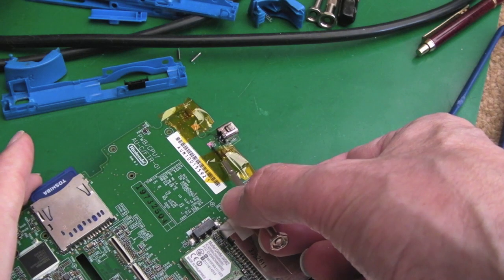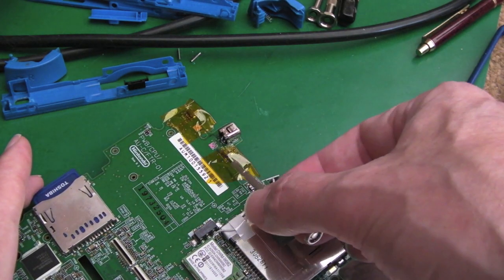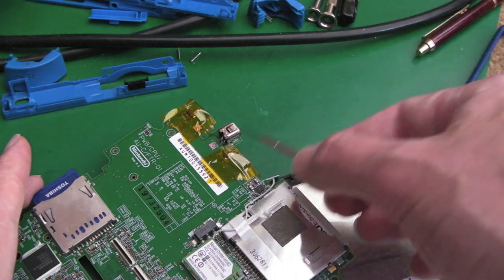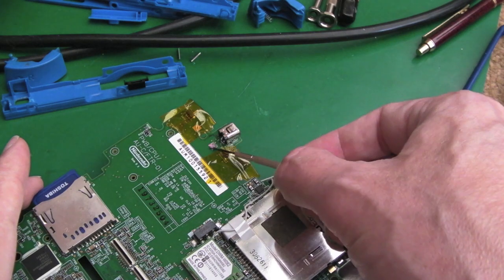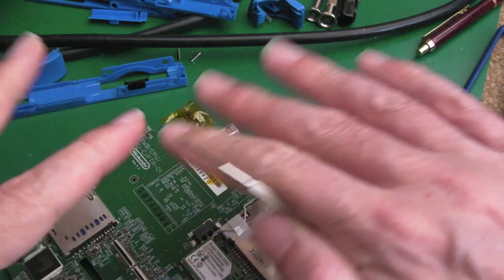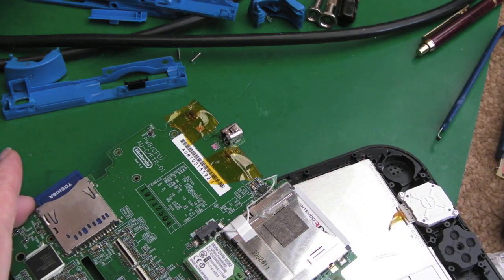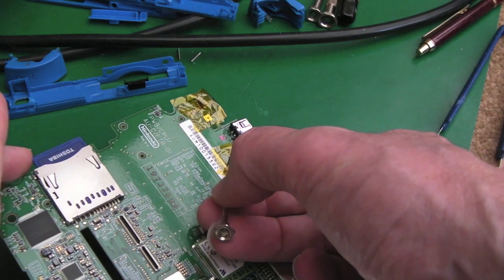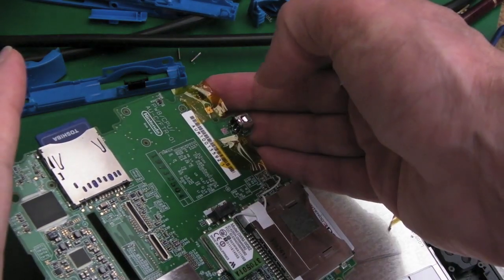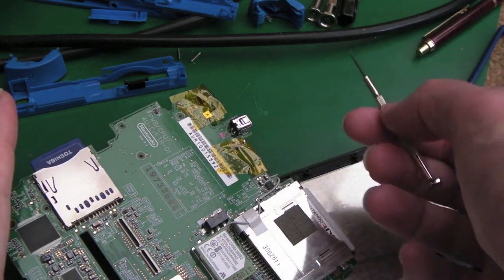You can see the sticky pad there. Normally it's white with little red dots, and you can see it's all blurred there, which may make you think this has been water damaged. It hasn't, because that's what that pad does. The red blurs out when it's got wet, so it's a water damage indicator. But it's like that because when we first did this, we just got some flux on there and reflowed the connections. I can't see from that distance, but trust me, we did some good connections. It's worked ever since I did that repair in the previous video.